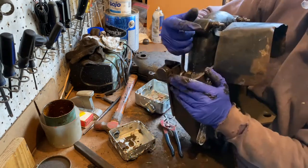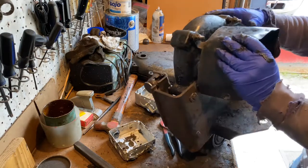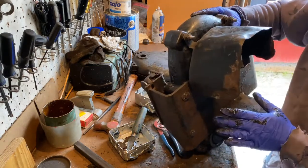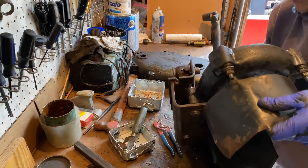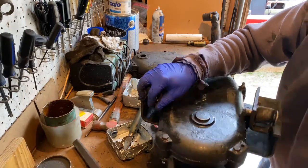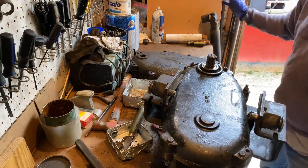Getting it lined up — I'm turning the nut, not the bolt. Make sure that nut's good and snugged right in there. There you have it — everything is back together. You'll see a little blooper in just a second where I missed the piece and had to take this thing all back apart. But there it is. The next thing I've got to do is put the shaft back on that goes under the vehicle, and we'll probably do that as a separate video.